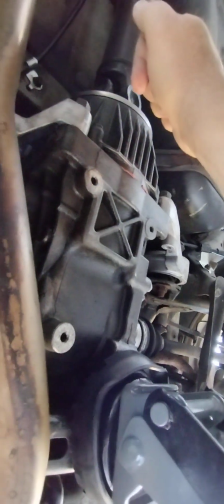It's ruined. First thing we're going to do is remove this tailpipe, these 2 nuts, and then it's got 2 hangers, one here and one back here on this. And then we'll remove the drive shaft. There's going to be 4 nuts holding that on, and I've checked this drive shaft, and it's really solid. There's no play in it at all. So at least that's one bonus, one nice thing about the car is that's in good shape. So the 4 nuts to remove this, and probably the 2 over there on the middle support, so I can lay it on the ground.